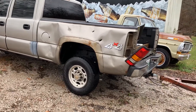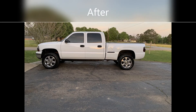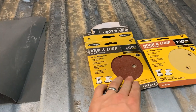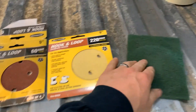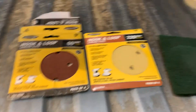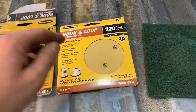This is what I use for sanding. If I do any bondo work or need to take paint off, I usually use somewhere around 60 grit. If I'm just scuffing the paint, I'll use 500 on a block, and a scuff pad for jams and curved areas you can't get into — especially on the step side in the creases. For pretty much the whole truck, anything I paint, I use a DA with somewhere around 220.